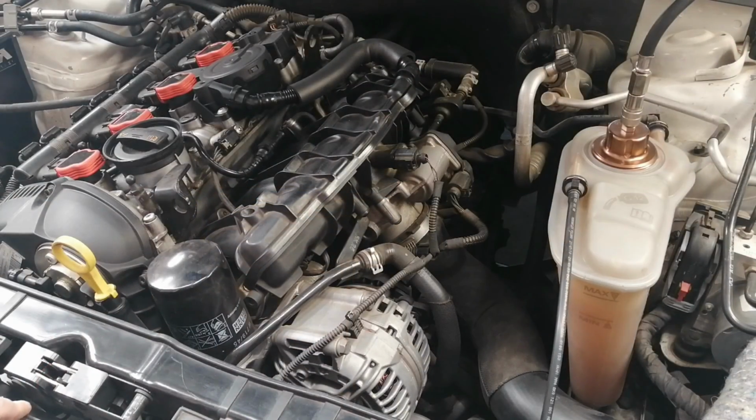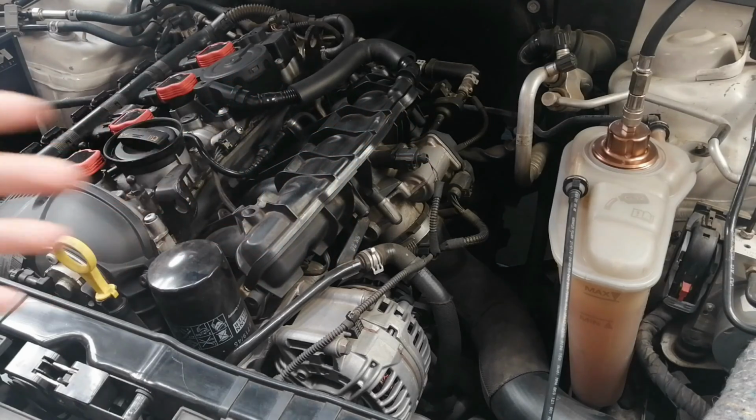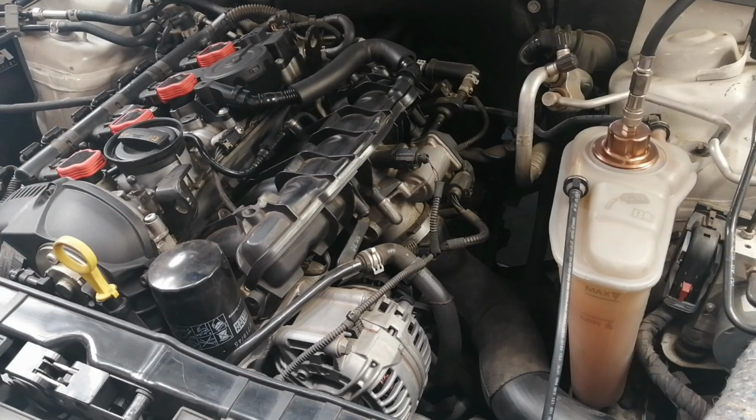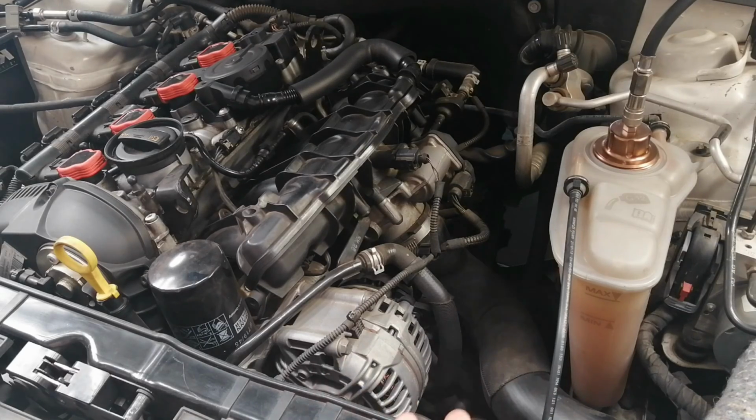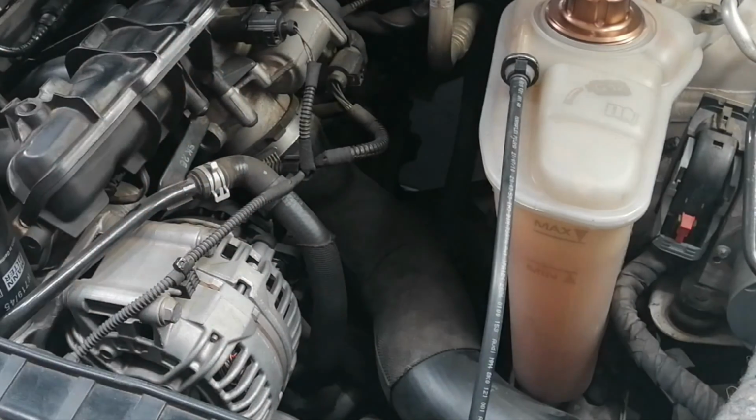After further inspection, we notice that the leak is taking place underneath the intake manifold, which is possibly the water pump. So for us to have better visual access, and also for you guys to see what it might be, we are going to remove the boost pipe that connects to the throttle body.